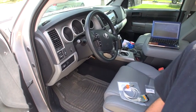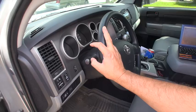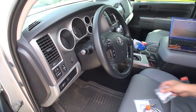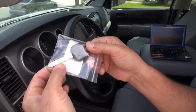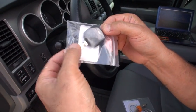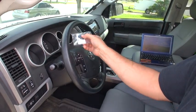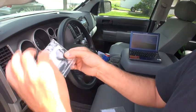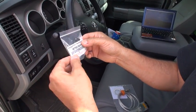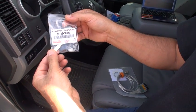What we're going to do today — this is a 2013 Toyota Tundra — we are going to program a brand new key for the immobilizer. This is a brand new key that is not even cut. We're going to program the chip so it will work with this truck. After it's done we can take it to the locksmith and have it cut. If you don't want to do it yourself, you can go to Toyota and pay them sixty or seventy dollars to do the same thing.